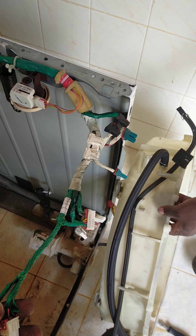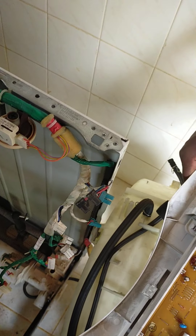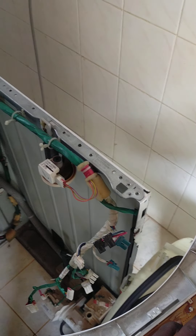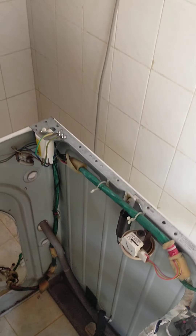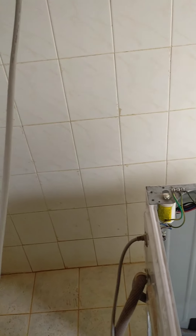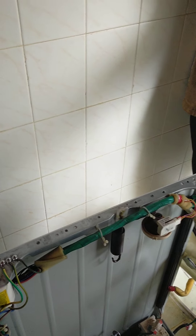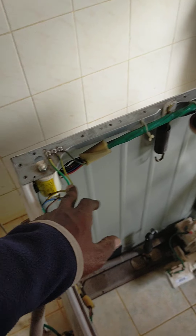These are just the cables that go to the PCB. When it's powered, power comes into the sound filter first — this is the sound filter. If the machine is not powering, it's either the PCB has a problem, the sound filter has a problem, or the main socket fuse has a problem. If the sound filter and PCB are okay, check the entire power cable, as it may not be allowing power through. Most of the time it's either the PCB or the fuse — it's rare to find the sound filter as the issue.